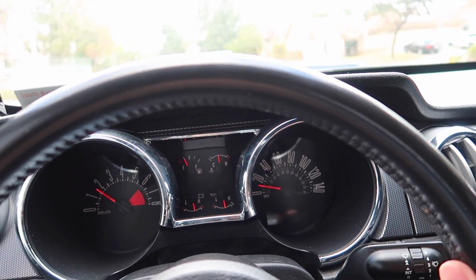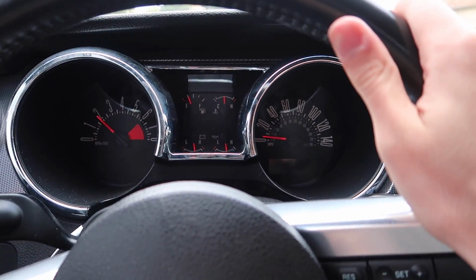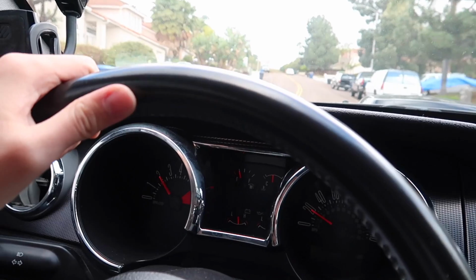All right, now let's go ahead and talk about the gas mileage after I installed the hot rod camshafts. I actually went from having about 15 in the city and 18 on the highway, and most of my commute is highway. After I installed these camshafts, I feel like I am filling up at the gas station every 5 days. It went from 6 days to 5 days, and I went to 14 miles per gallon in the city and about 17 miles per gallon on the highway.